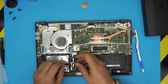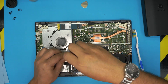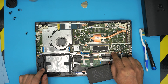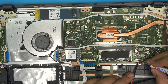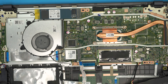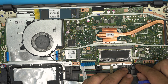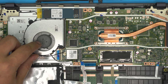It has a little adhesive, so rip it off and bring it upward. Remove the three screws and two screws and three screws on the battery, then lift up the battery and move it to one side. To unhook the battery jack, there's a little latch on top — pull the jack backward towards the RAM about one millimeter, then lift it up towards the ceiling. Don't use anything metal underneath — use a plastic tool. That's how you remove the battery connector; it comes up, it doesn't slide out.